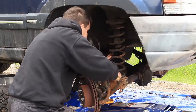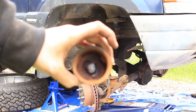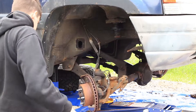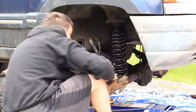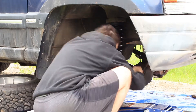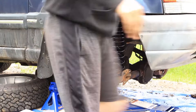Removing the spring at this point is pretty easy — just remove the retainer on the bottom and pop the spring out with a big screwdriver. For the bump stop, you have to put a big pipe wrench on it and you can actually unscrew the whole thing. Removing the old spring isolator will likely take some time; after so many years it gets stuck on there pretty bad, but with some flat screwdrivers you can eventually pop it out. The new one will go on much easier and don't worry if you can't push it all the way up to the top — the force of the spring will do it for you. Use some silicone grease when pushing your new bump stops into their cups; it helps to do it when the cup is not in the car so you can push it against the ground.